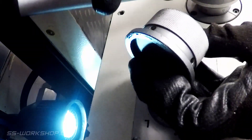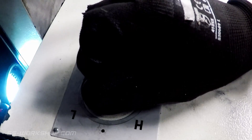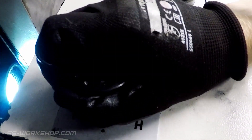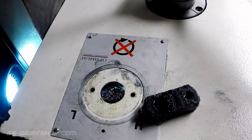The knob is secured with a small set screw in the side of the knob. There are also two ball bearings and a spring that will come out from under it. Next remove the set screw securing the shifter, and the two screws that are under the shifter knob. This will then allow the shifter mechanism to be removed.